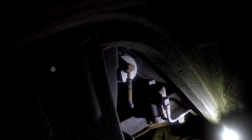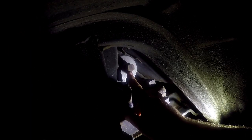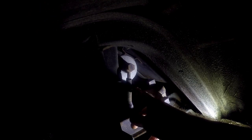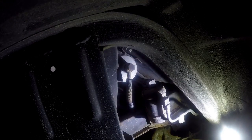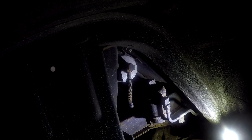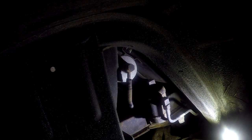To replace this fuel filter is quite a challenge because you have very limited space to work with. You have to loosen the inlet pipe and the outlet pipe, which are bolted onto two flanges with size 19 special bolts. On top there is a bracket that holds this filter in position. We discovered it's a star screw at the top that you loosen up to release the clamp holding the filter against the body.